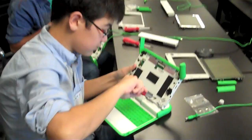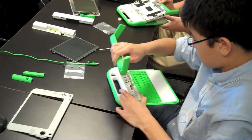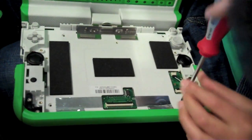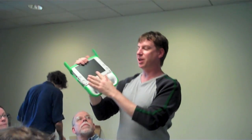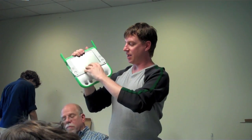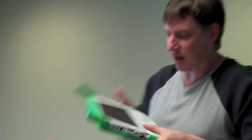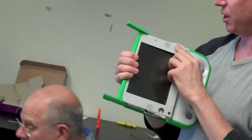So you can put the LCD back in it. You can do this last thing before you put this plate on. You don't need to hold it, and it'll be easier to flip it around. It doesn't fit because there's a gap right here — it doesn't just press on. It locks in, so you have to be below the tabs. There's a small tab right here that fits in a slot and slides up and hooks. If you have this gap here, it's because you don't have it locked in.